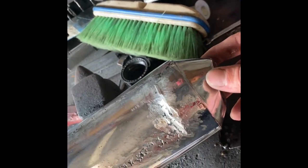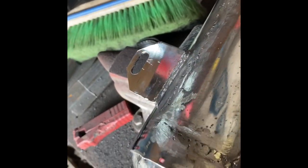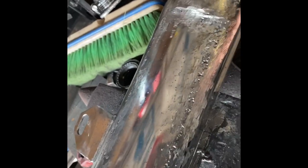Since this is going on a dirt bike and it's going to get wet and rust — the pipe is actually stainless steel, but I don't want my welds rusting out — I'm going to mask it off and take some engine enamel in aluminum color and just spray it. This is the back side of the muffler, and the front side kind of looks like that. I'll clean all that up and you'll never see it unless you climb underneath the fender well and look in there.